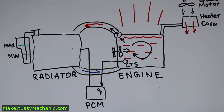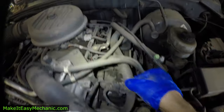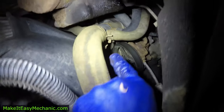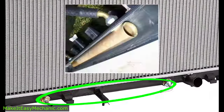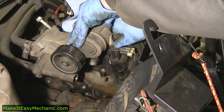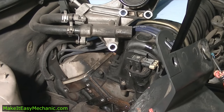Those are all of the major components of the cooling system. There are also radiator hoses and heater core hoses connecting cooling system components, various housings that serve as connection points between hoses and the engine, and oil coolers. For example, following the lower radiator hose there are two hoses attached to the oil filter housing for coolant to flow through and cool down the engine oil. Radiators often have a cooler on the inside for automatic transmission fluid to flow through. Sometimes there are specific cooling system designs where coolant flows through a belt tensioner, though those components are more of an exception rather than the rule.